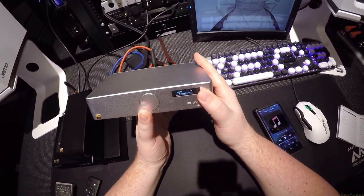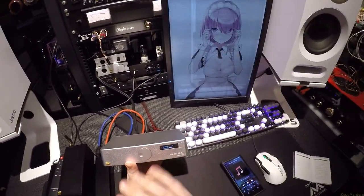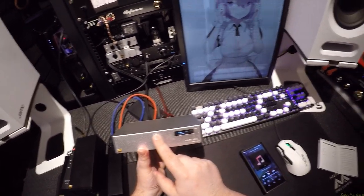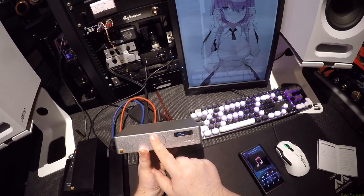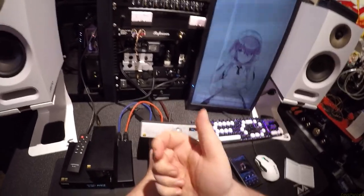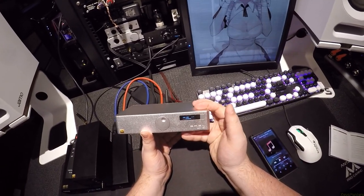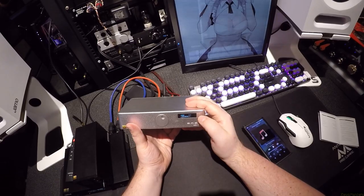So we have the first screen — one to seven is inputs. The second screen is Bluetooth setup, turn to reset. You just turn the knob in any direction on number two — it completely forgets your Bluetooth device and disconnects it. Don't fuck that up. Number three is EQ mode — you switch between direct, SBD, or tone. Number four is treble — you can take it up 10 or negative 10. It's a very basic tone control. Number five is bass. Six is display mode — I have it set to show me the volume when nothing's going on. And seven is brightness.